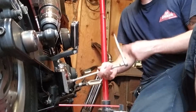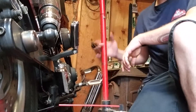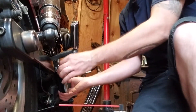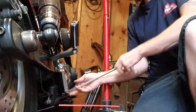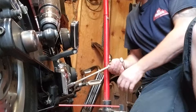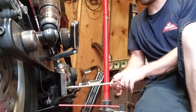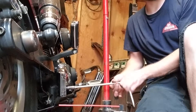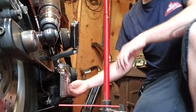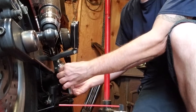It's two bolts on this, and it's a Vance and Hines — I think it's a short shot. I really don't like it. The shields have little sintered retainer plates that keep cracking off, so I keep having to reload them. I definitely want to get a two-into-one on this bike — I just don't know what yet. Even the cheap ones are like 650 bucks, but I definitely want to put a two-into-one on the bike.